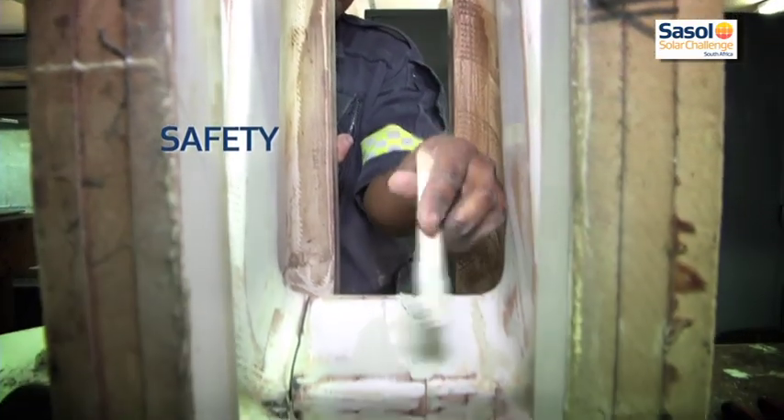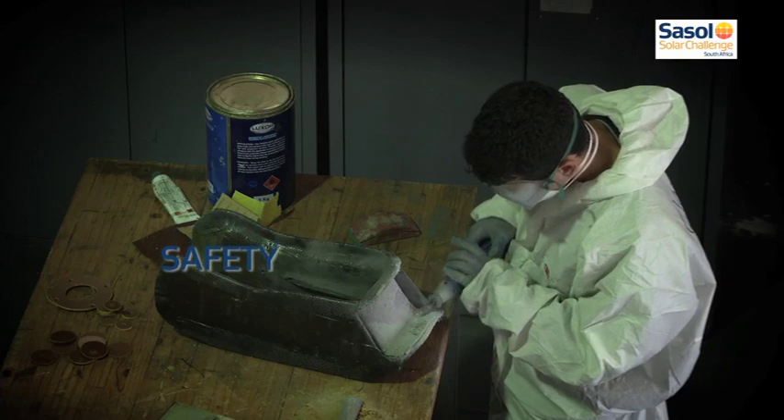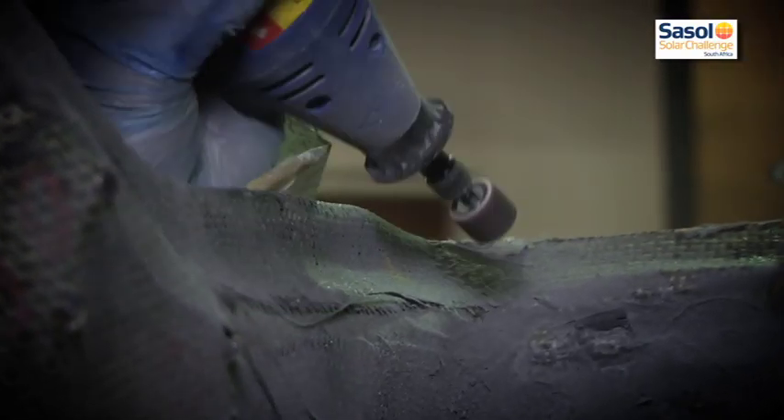That's mainly because we had two converging-diverging ducts out the back which totally messes up the air, and that just wreaks havoc. You have to make sure that the driver is safe at all times, so we put extra, thicker layers of carbon around the driver, and also a layer of Kevlar, because carbon can snap but Kevlar doesn't.